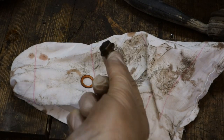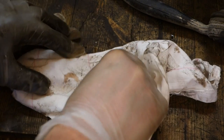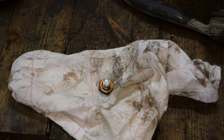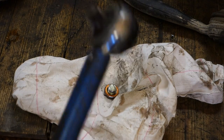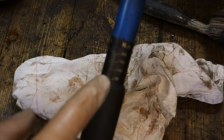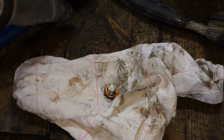Okay, and when we have this automatic transmission gearbox drain plug and this bolt, it's good to clean it with a cotton cloth, and then remember to install this gasket and this plate. Then we insert the bolt back, and it's good to use this torque wrench tool with a force of something like 20 to 30 Newton meters, and then this plug will be fine. And then we go to insert that back.